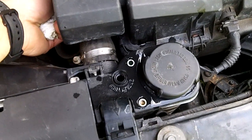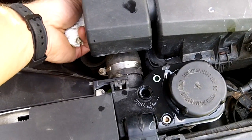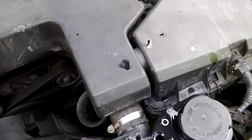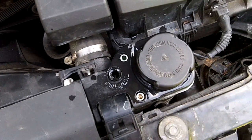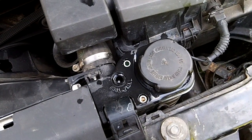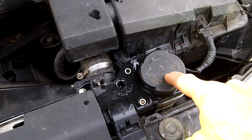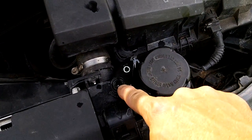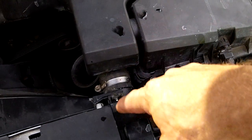The water's pretty much to the top now. I'm just pulsing the hose a little bit — it's bubbling up. I would consider that pretty much bled. Some people will let this bubble over for a couple minutes. I'll probably come back and check this again a little later, just to make sure all the bubbles are out. When you fill these up with water again, make sure to put radiator fluid in here and make sure you see water coming out of here.